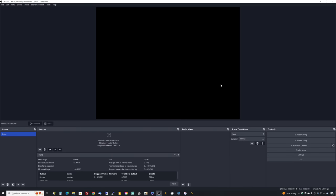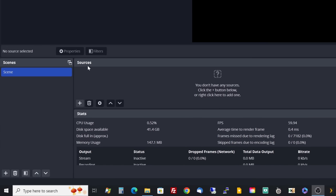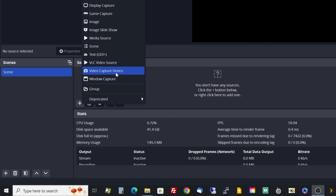Hit OK and you'll see that our canvas has been resized. At this point, it's good to start your source playing so that you have a signal to examine when you hook up your capture device. Go ahead and put any tape into a VCR and start it playing — that will be our test signal. Then connect the video and audio leads from your VCR to your capture device. If you're using composite video, the video connection is typically yellow. For left and right audio, the red lead is the right side — red is right, easy to remember.